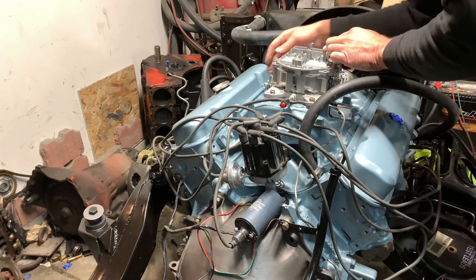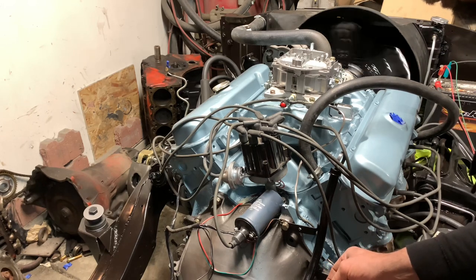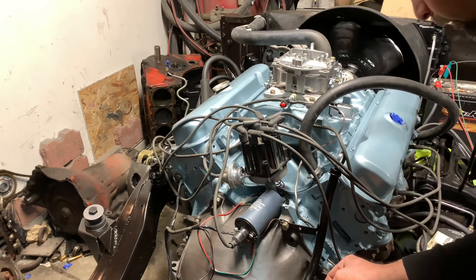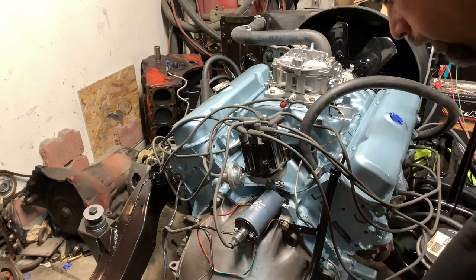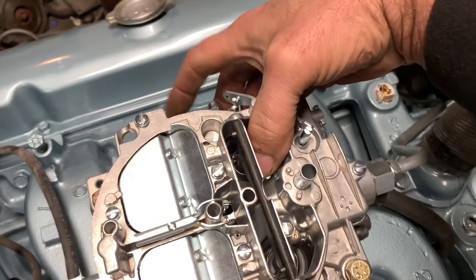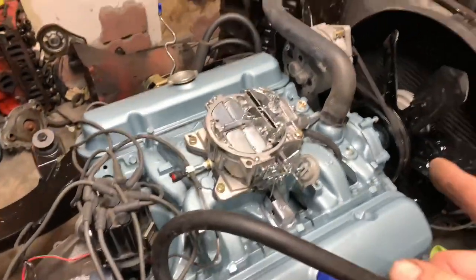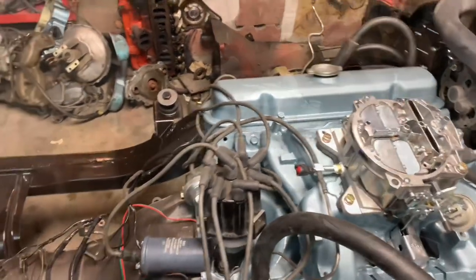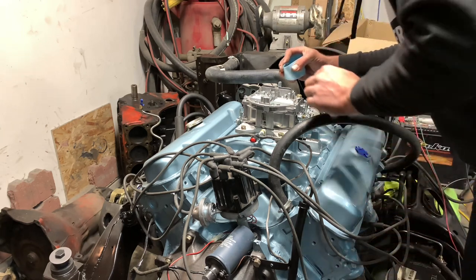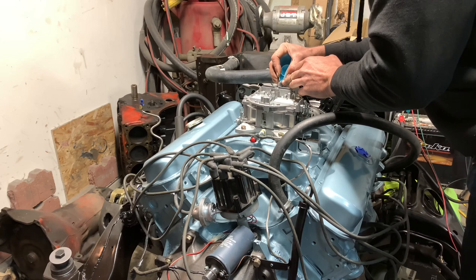I've cranked on here for a good bit and nothing - I'm afraid I'm going to kill the battery. Hit the accelerator, still nothing. The other thing we could do is dump some fuel down into the fuel bowl and cheat a little bit - that way the engine cranks quicker and maybe gets the fuel pump to work. I'm going to get a little bit of fuel and dump it down in here. I love these paint caps - they turn into a perfect little funnel to get fuel to go where it needs to be.